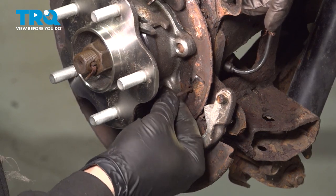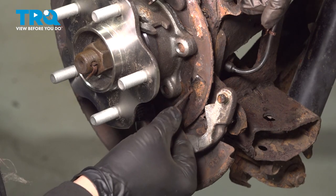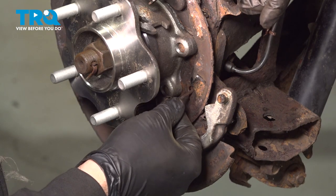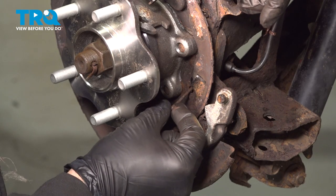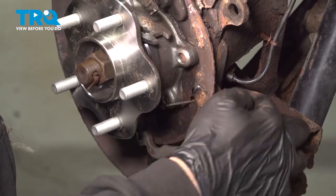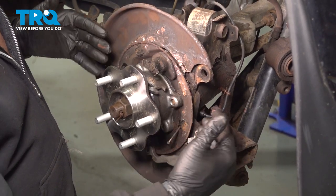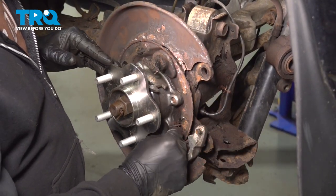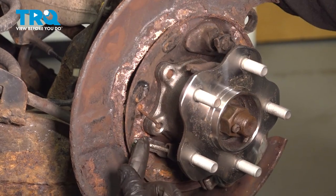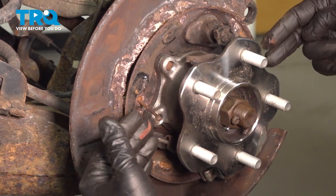On the backing plate there is a pin here and a pin on the other side as well. These come through to the spring clip that we removed off of each parking brake shoe. Inspect these — if they're rusty, replace them. The rearward position pin can't come out through the back because it hits the knuckle; you'd have to loosen the four hub bolts, pull the whole backing plate forward, then replace the pin. Our pin is in good condition so we'll reuse it. Repeat the same process for the forward pin if it's rusted.